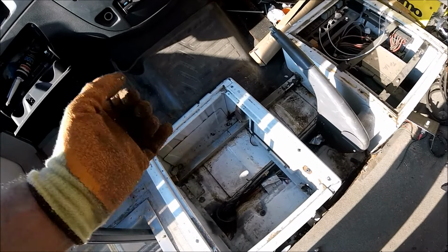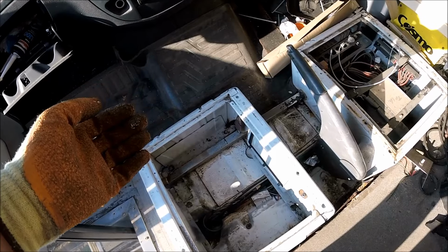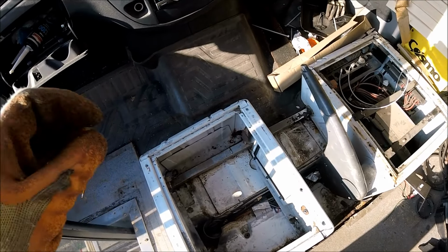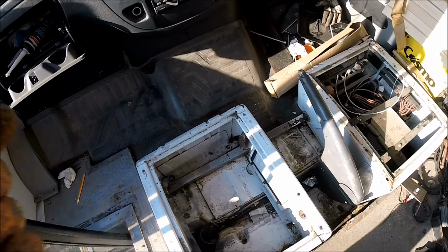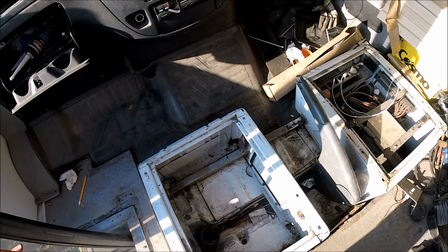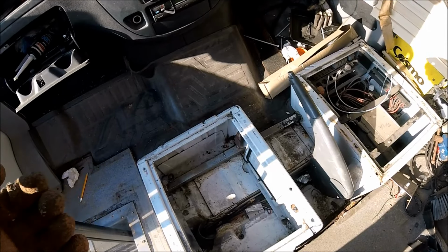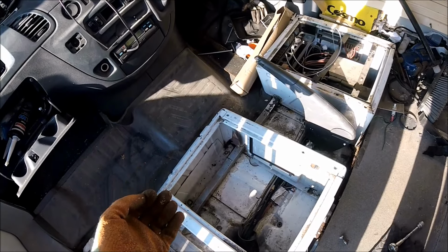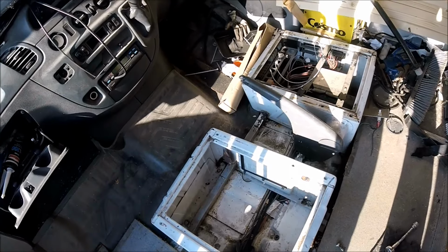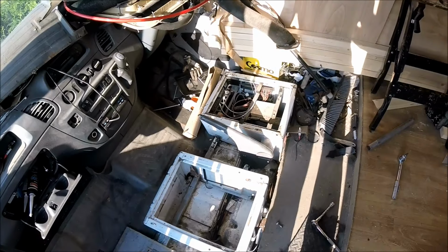So I've been underneath the van, checked this, it's pretty clear underneath. Doesn't look as though there's going to be any obstructions. So I'm just going to poke a small drill bit through first, just to be sure, as a little pilot hole. If that goes through with no problems, I'm going to widen out the hole, then I'll be getting some nice big strong high tensile bolts, bolting the base through with a little spreader bar underneath, just to spread the load of the base itself, and then I'll be able to finally get the seats mounted.